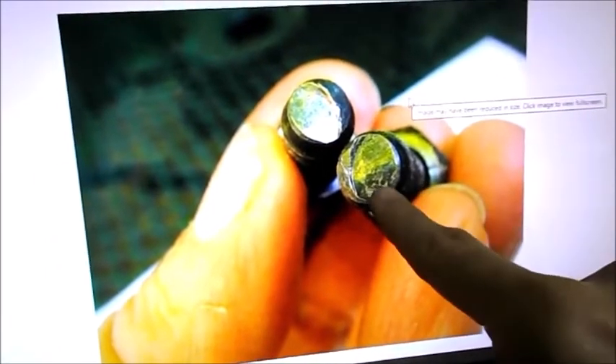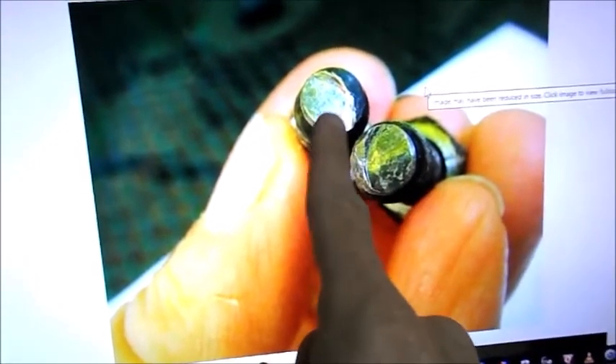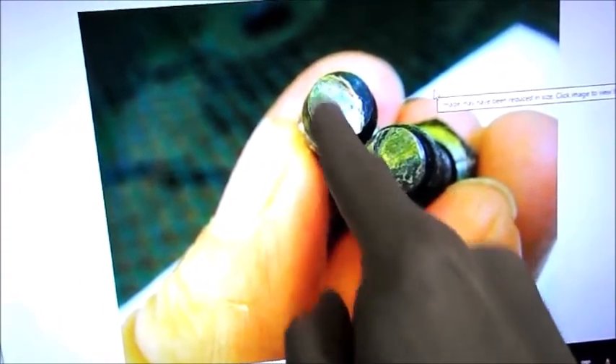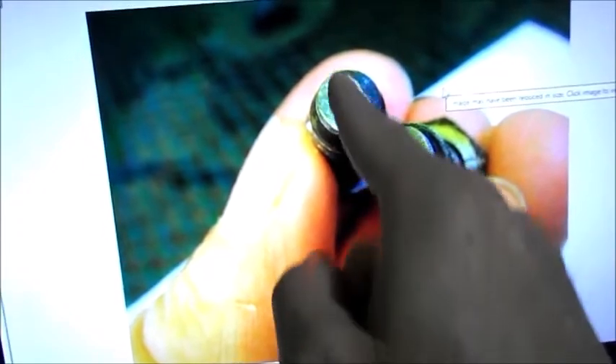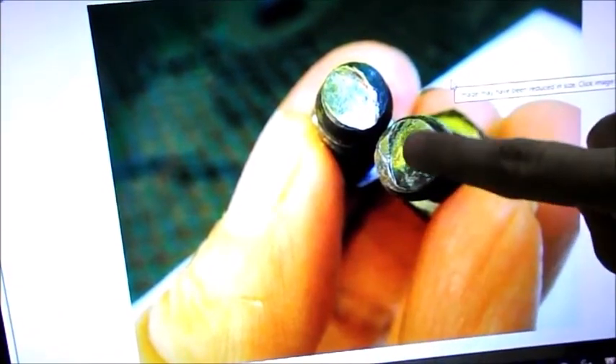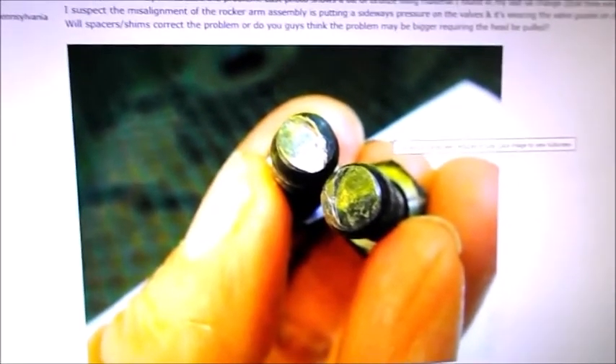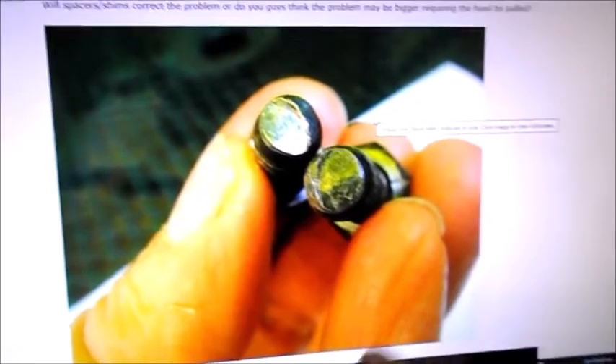This is what's happening in your motor. This is why you don't need an offset. Now here are some tappets — see that line right there? That is because somebody took their tappet and offset it from the center of the valve, so it ended up wearing badly. There's another one. They went with an offset and got bad wear on the tappets.